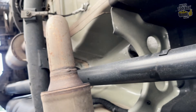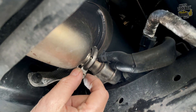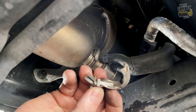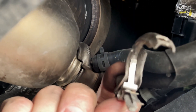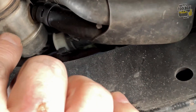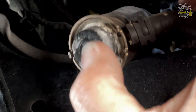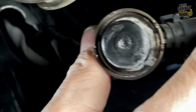What you need to do is remove this bracket here. Get your Allen key and remove this bracket — I've already pre-loosened it, so we'll just pop that off. Don't lose the little spring bracket inside there. That's where the spring bracket goes inside right there. Remove the other bracket, and now you can wiggle out your injector. What you'll find is a whole lot of crud coming out.